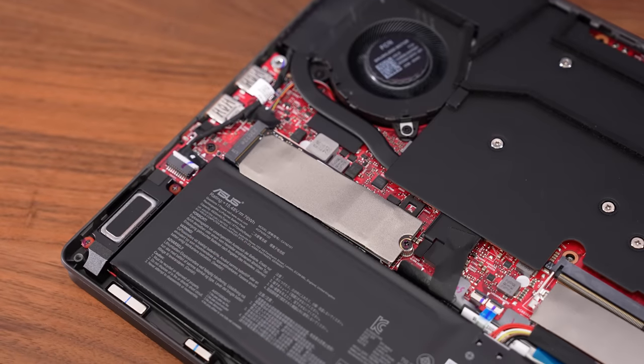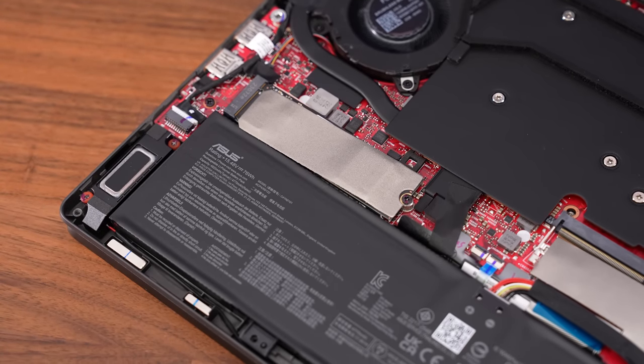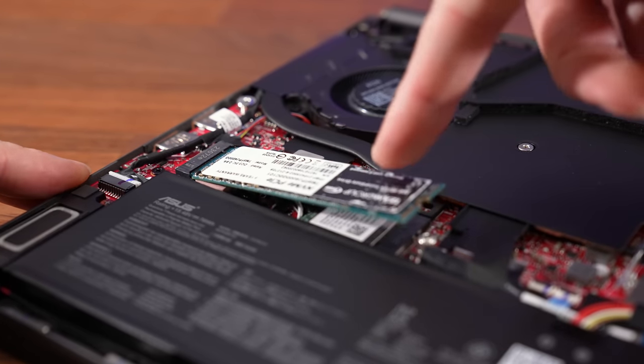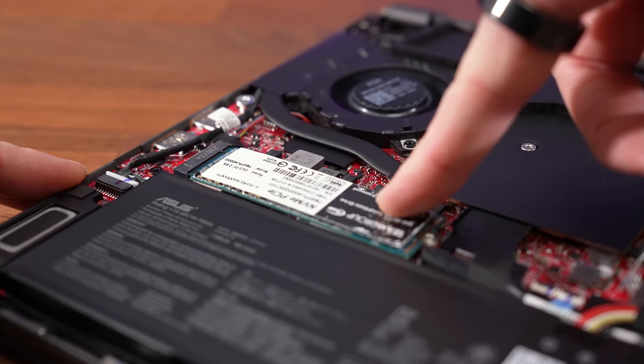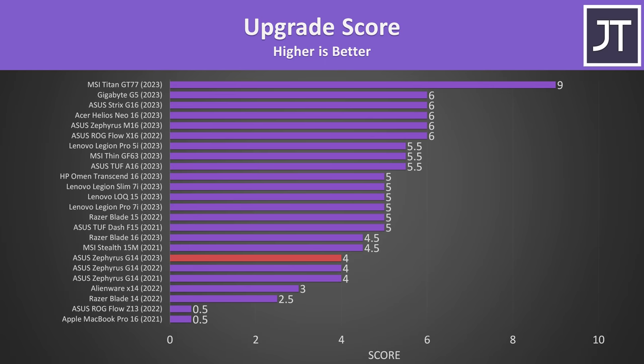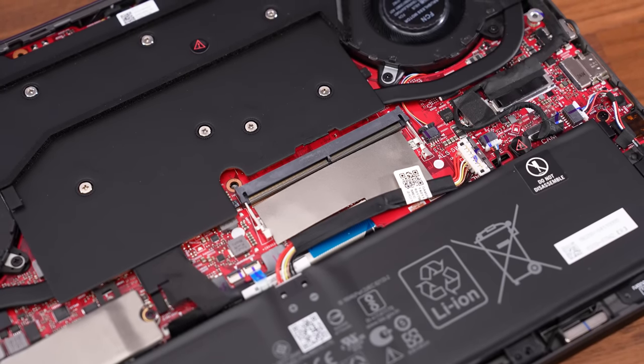You can upgrade the SSD yourself, but as there's only one M.2 slot you'll either have to clone the drive or reinstall Windows. Although there's only room for one M.2 drive, it can at least fit double-sided drives. The upgradability score was the same as previous G14s - we can change the single SSD, WiFi card, and one RAM slot. Other 14-inch laptops this year, like MSI's Stealth 14 and Razer's Blade 14, now have two SODIMM slots, so the G14 sticking to one isn't as good in terms of upgradability.